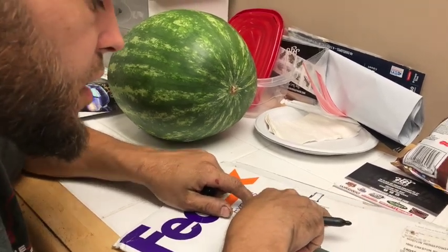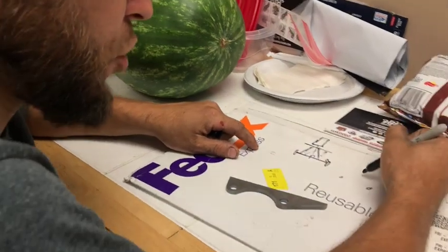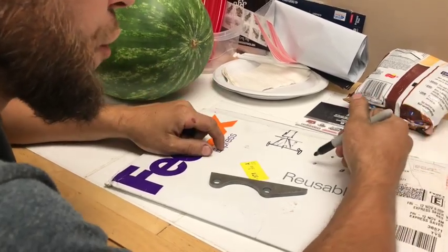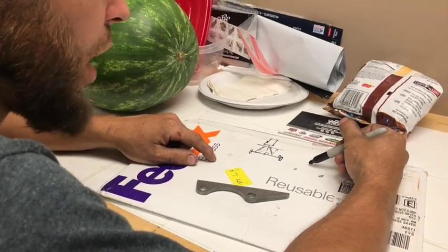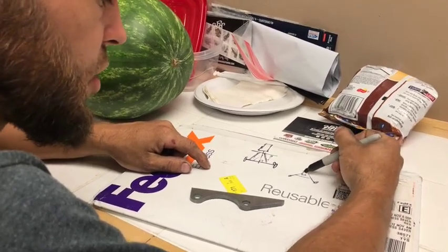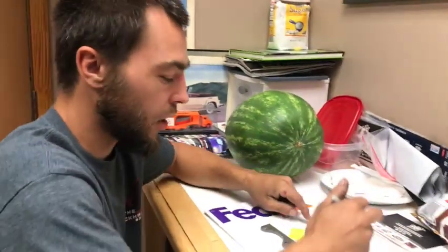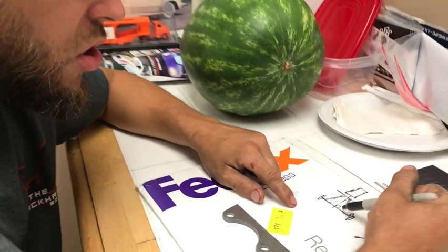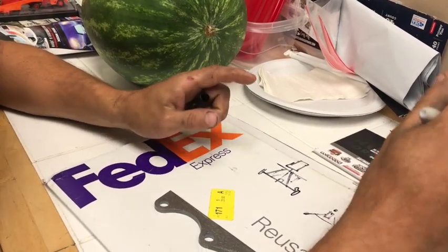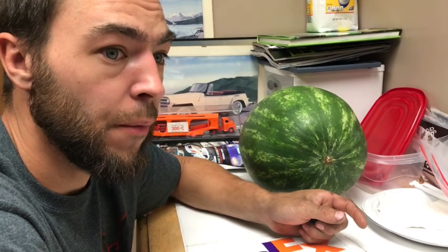You have to have a way to keep the rear end centered. You could do a wishbone setup — two points on your axle or chassis with a single point on the opposing one. If you have two points on your axle and one point on the chassis, you'd have a slip joint, all connected in a triangle. This shaft would slide in and out as your rear end goes in motion, because that distance from the rear axle to wherever the bars attach on the chassis changes slightly. That's why you run a slip yoke in your transmission.